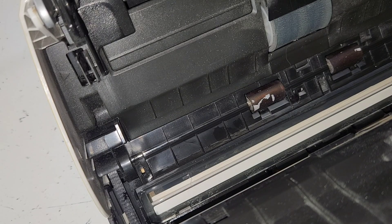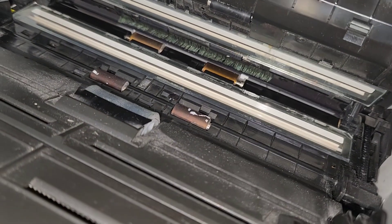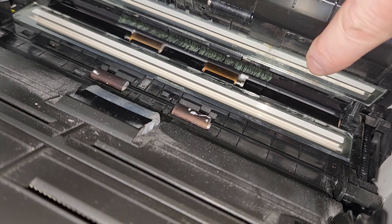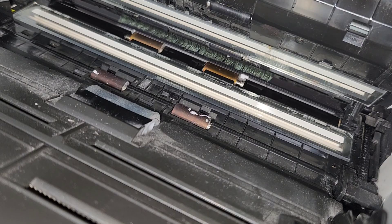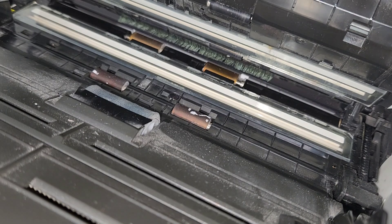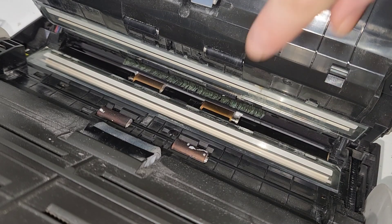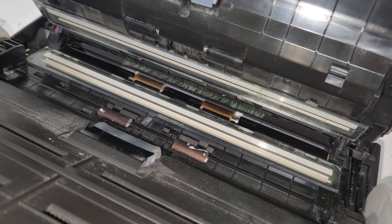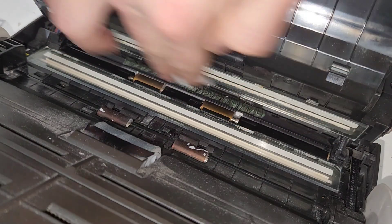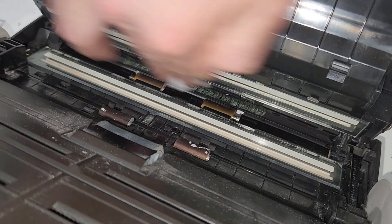Just go ahead and wipe the glass part. Keep in mind, this is a double-sided scanner — so it scans on this side and also on the opposite side of your page or document right away. And this one is over here. You can see how that one is dirty also. Here's my alcohol swab — you can see how dirty it's getting. Here's a closer look at that problem. On that other side, you can see how dirty that is. So we need to clean that as well. Then I like to just wipe it down with a dry paper towel or a dry, very clean rag.